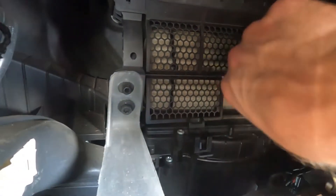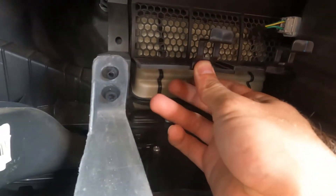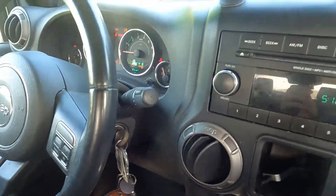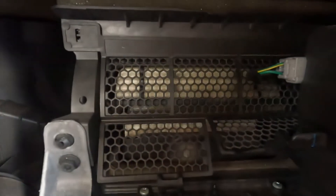You should just be able to prop that open like that. You can prop this one open too. But now the vent right here is covering our filter. So what you got to do is turn the key to the car. You're going to push the recirc button — you want it pointed on your head, so recirc. That door opens right up.